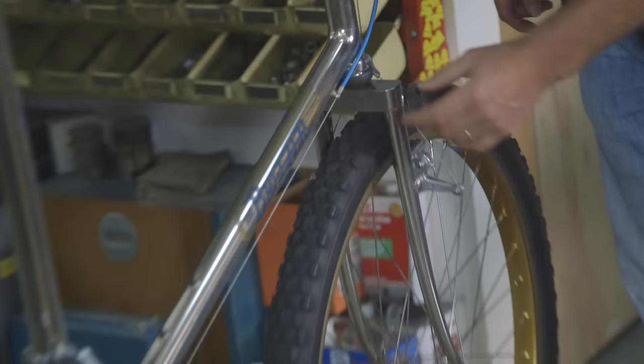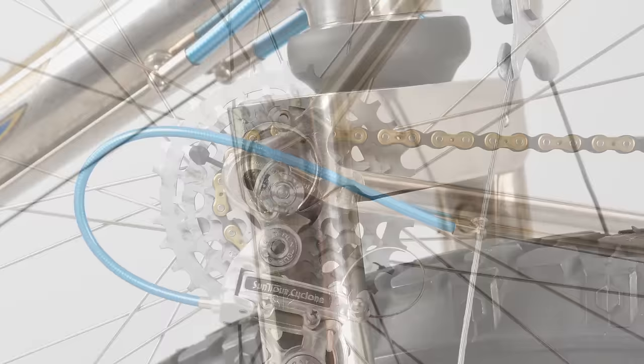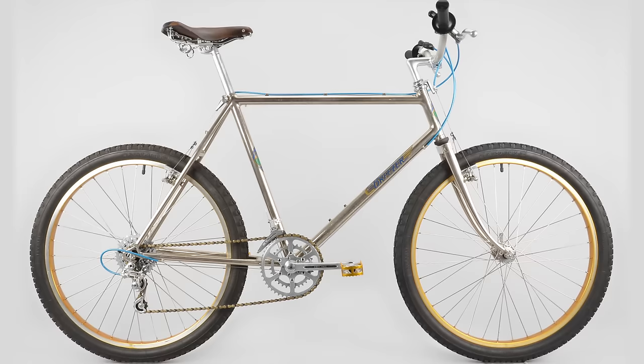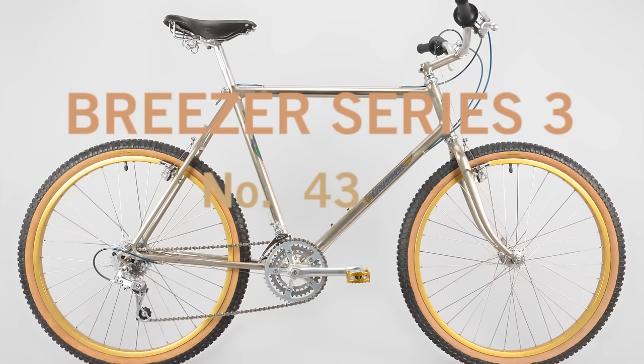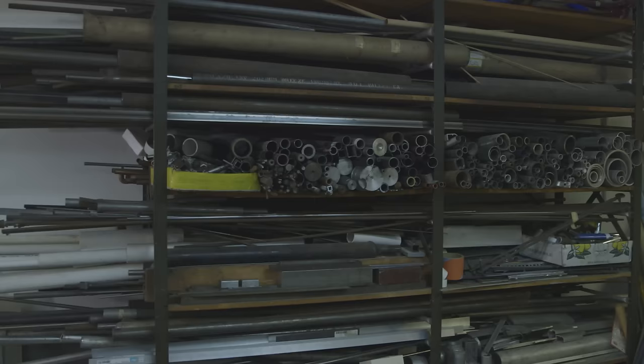It's a piece of rectangular steel bar stock that I pierced to make it a hollow crown. This time I used Campagnolo horizontal dropouts, and I guess I had a little shorter chainstays on these later bikes. This is a 1982 Series 3 Breezer, and the numbers started not at zero but at 25, I believe. It's possible I cut tubes for 50 — I can't even remember now.